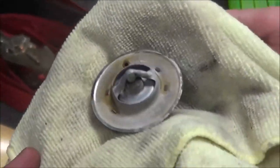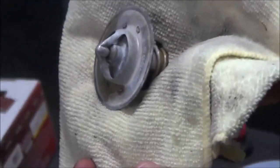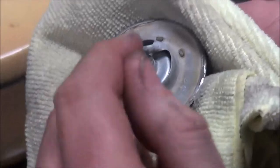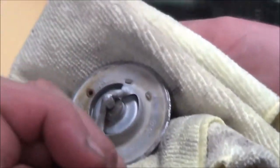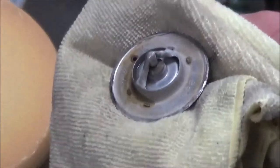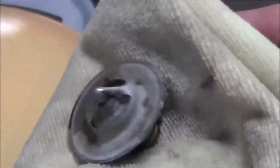This is going to close back up fairly quickly — in a matter of probably 30 seconds or so, especially if I don't stand over it, this will suck itself back up. You need to be really careful with that. If it were me, I'd have my vernier caliper ready to go so I could measure right off this edge. If the service manual says it needs to open, say, five millimeters, have it ready to go and test it. Do you want to get your fingers in there as that thing's closing? No — even with rubber gloves.